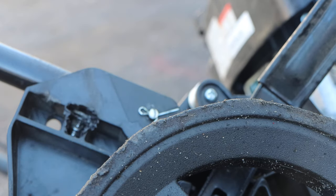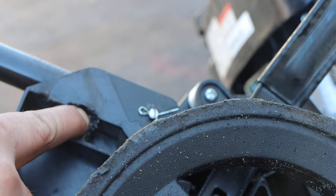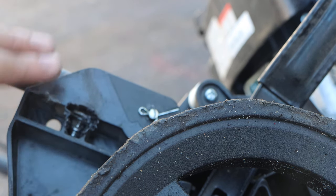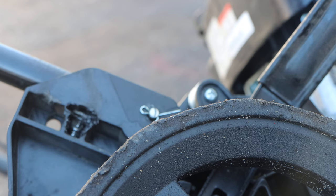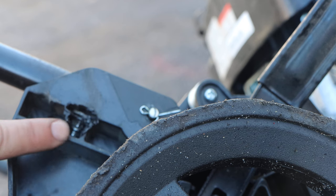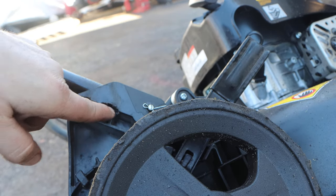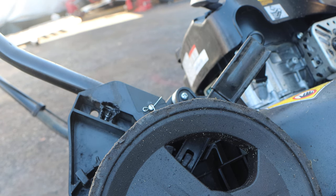110% — not the prettiest repair. But this repair cost us two washers that we had laying around, so for you guys less than a dollar, plus the nylon lock nut. We're reusing what the factory had — what they failed to do in the first place. If they had put in a bigger washer or used a little bigger hardware, we wouldn't have this issue. If you look at your traditional MTD lawn mower, they actually use like a square and you slide the square in the hole and twist it. So this repair is absolutely good to go — this is a viable repair.